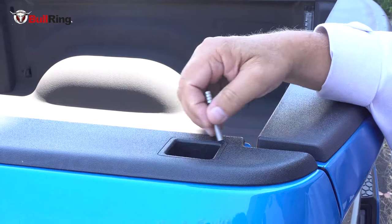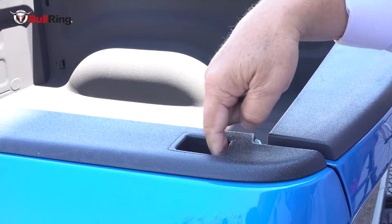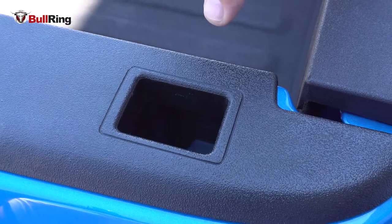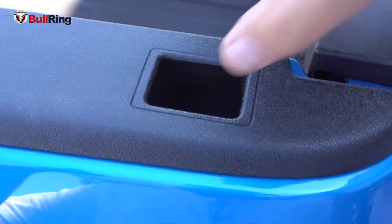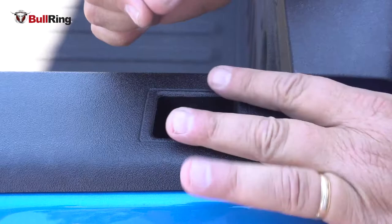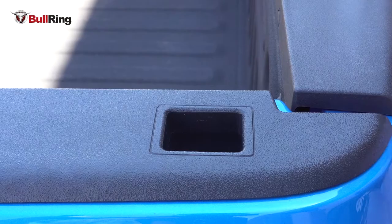The rear pocket has this scribe line right here, and as you can see, the plastic rolls over the edge and goes down about three quarters of an inch, and it's open at the bottom. Most guys think that this is pre-cut because it's open down inside there. But the cap is actually not open, because that plastic is still preventing you from having the bullring go in there and grab the steel on the left and right side. The bullring wants to get hooked up behind this downturned edge on the left and right side, and when you pull up on it, it can't come out. We drop the cover, it makes a sandwich on the rail, and that allows the ring to move up and down independently.